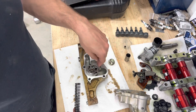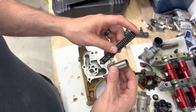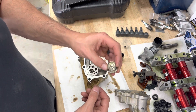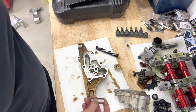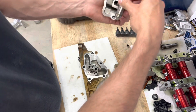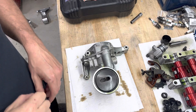This pump was out of my stock motor that failed a main bearing — it spun a main bearing — so there's a little bit of material in it. You've got to take everything apart. This is your check valve, your pressure relief valve out of your oil pump. It gets to a certain pressure and this opens, allowing pressure to bleed past the filter system. You want to take all this apart and clean it really good because there could be metal down inside and then you'll find it back in your motor. To reassemble: the bucket slides back down inside, spring goes on top, put your cap on, add a little assembly lube, and bolt it back up.